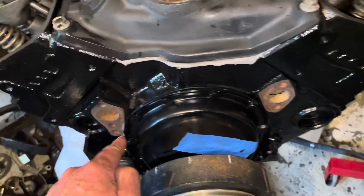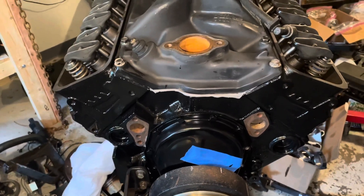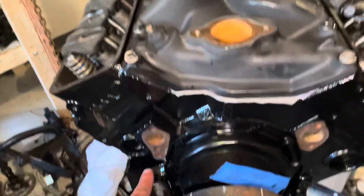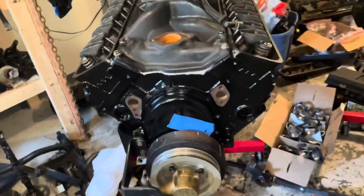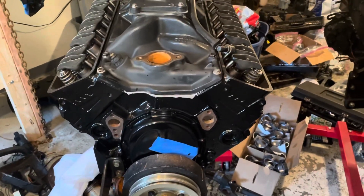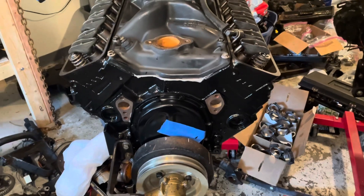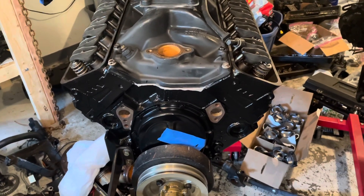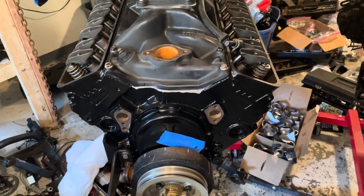If these were not Vortex heads but pre-1996 heads, the bypass would be active and water would be spurting out of the uncovered hole. With Vortex heads you're pretty much okay with either type of water pump, but if you're not using Vortex heads, you have to make sure the water pump matches your block's flange. I'll finish installing the water pump now. Thanks for watching — please subscribe if you found this video useful. Closed cooling systems work a little differently and I'll cover that in another video.